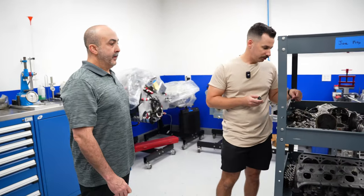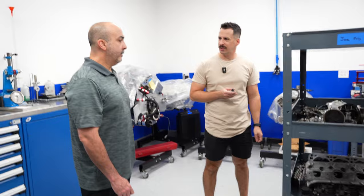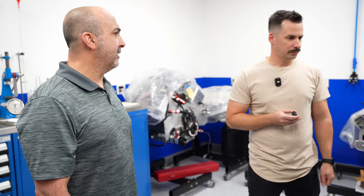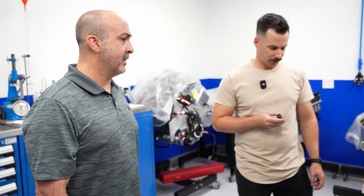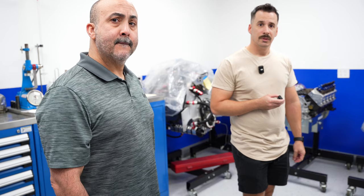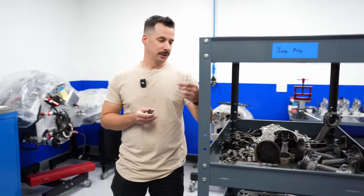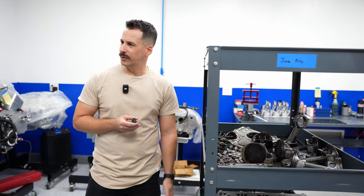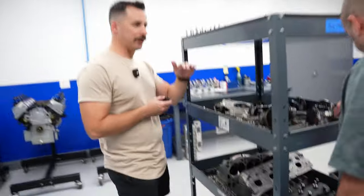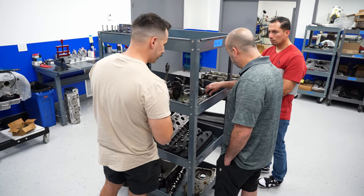And the rods — nothing. Everything looked fine on the rods, visually they all look good. I've heard people magna flux them to check for cracks. Not something I would think you'd need at this point. These rods are titanium but they have a coating on them — how do they test if the coating is weak or not? If it starts flaking off, I would think. Blackstone oil analysis is one value that has never increased in my couple of checks. The rod bearings are fine — all of them looked good. They're going to put new ones in but they didn't look like they were about to spin.